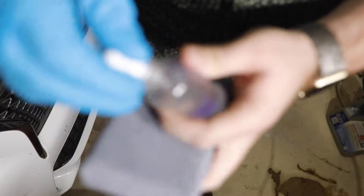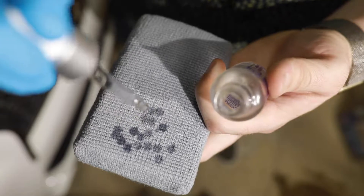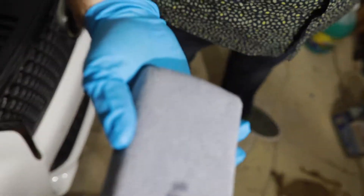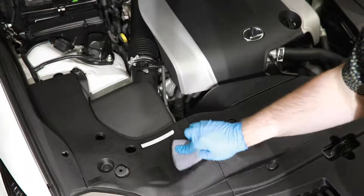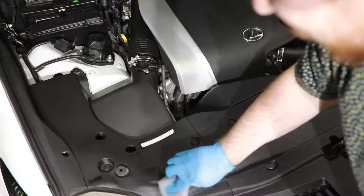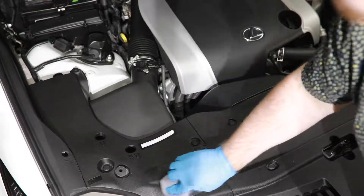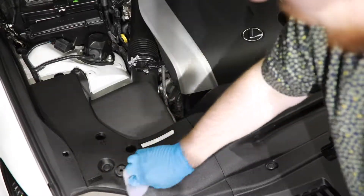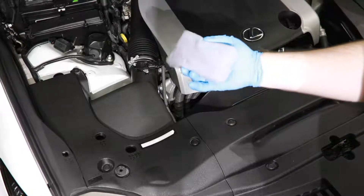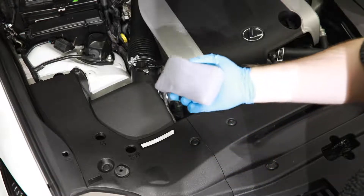For this application, just go ahead and remove your top, and I'm going to use a few drops on the pad itself to prime it and get it ready. Remember, always put your cap back on after you finish applying your product. Then move to the plastic and start working it into the panel with mild pressure — not too heavy, but enough to work it in and spread it around. I always recommend wearing a glove since these are, quote-unquote, glass particles. Let it sit for about 20 seconds or so before you buff back off with a towel, depending on your conditions.